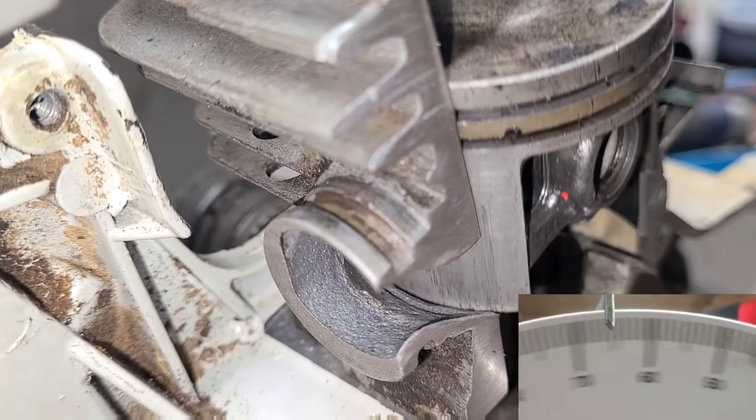Count on your timing wheel how far it opens and closes — that is your duration. Important warning: on a piston-ported two-stroke, do not have too much duration on the intake side. That will kill your saw — you'll bring so much air and fuel in that it will start compressing too much and bleed back into the carburetor. Note that adding two degrees to the intake adds four degrees of duration, because it opens sooner and closes later.